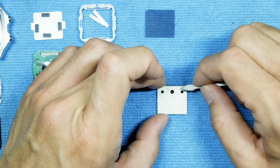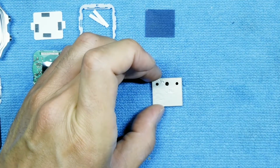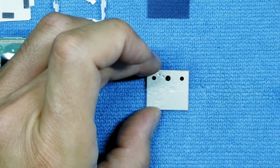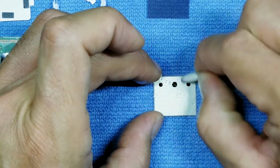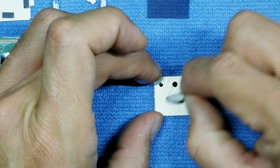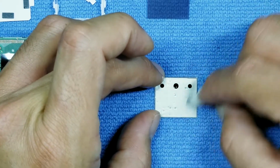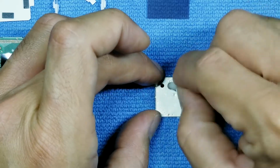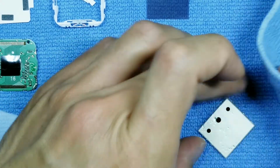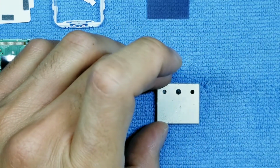All right, so we're just going to work from one part of the display, the top part. You'll notice that the Goo Gone starts to clump that glue together very well, which will hopefully make it a little bit easier to remove. And you'll see that I'm also working over a towel right now. It's probably best to work over a microfiber cloth. So we'll loosen up this glue. Once you get a few chunks collected together, go ahead and take your microfiber cloth and wipe in one direction.